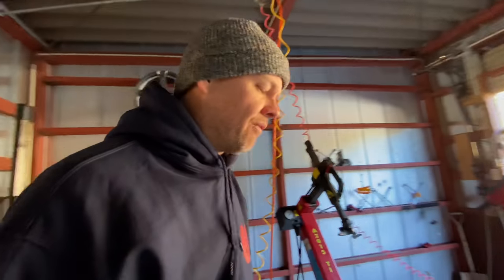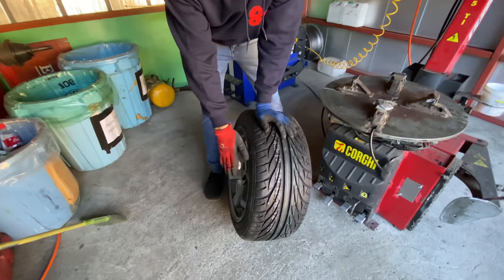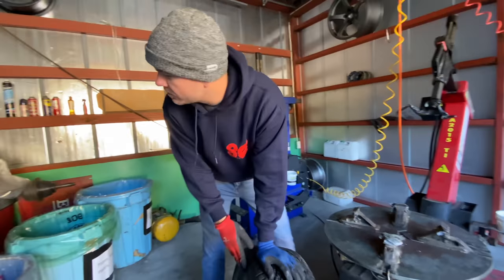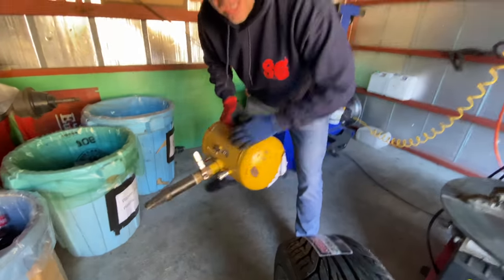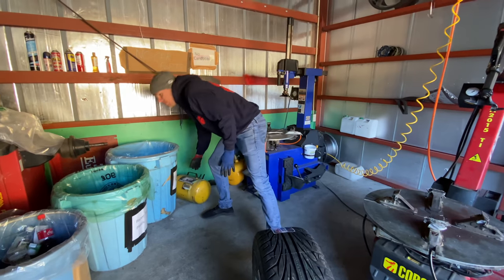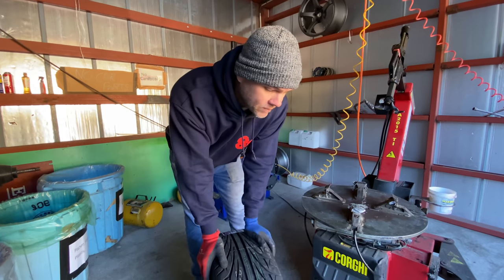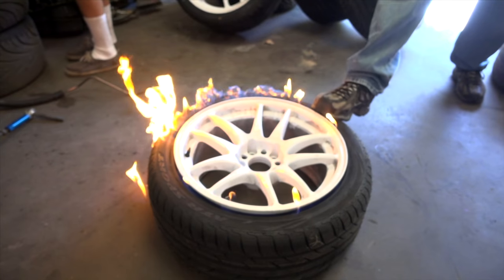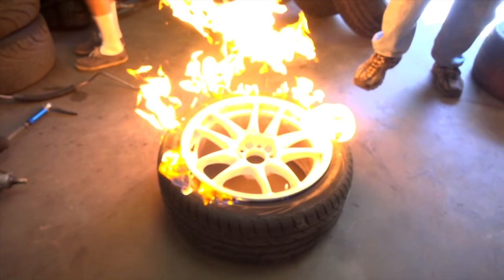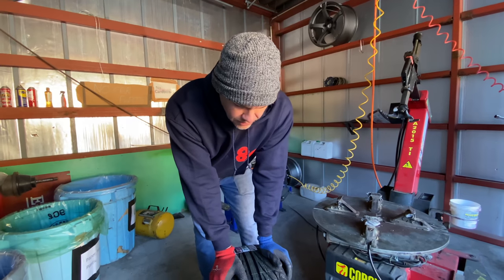Some big problems arise when you have too much stretch, which means a small tire, like a 215 on a 10-inch wheel or something. This is gonna be a big problem mounting it. You're gonna have to use fire, or what's called a cheetah, which is one of these guys, which you air up and put into the rim and explode, pushing a bunch of air in there to try and pop the bead up. But you're gonna need an experienced tire mounter there with you for your first time. And if you're using a flammable liquid, you're gonna have to get something very explosive, not gasoline, but like a brake cleaner or something like that. It's non-chlorinated, a very flammable version, not one of the low flammable versions.